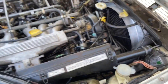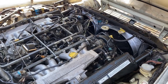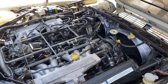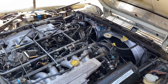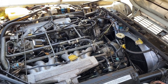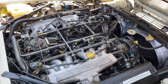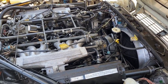I'm highly pleased with how it came out. Some pros and cons: you don't have to deal with the viscous fan, you don't have to deal with fan clutches going bad, you don't have to deal with the fan going yellow or the risk of it blowing up like some people have reported. You're also removing rotational mass from the powertrain, so in essence it should free up a couple of horsepower.